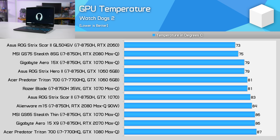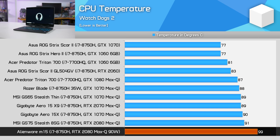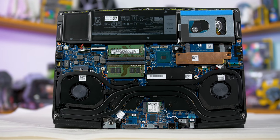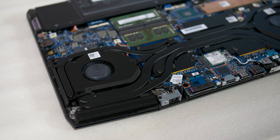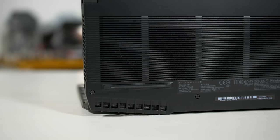Here is data showing the Alienware M15's cooling solution really isn't up to scratch for the hardware inside. GPU temperatures are actually okay — 84 degrees Celsius is fine for most gaming laptops — but the CPU temperatures are seriously high, with the M15 hitting 99 degrees Celsius during a Watch Dogs 2 gaming session. Anytime a laptop is up around that 100 degree mark, you're going to get throttling, so with this laptop it's mostly CPU throttling that's the primary issue. Raising the laptop's base sees a significant 7-degree drop on the CPU, and CPU clock speeds also increase by 500MHz across all 6 cores.